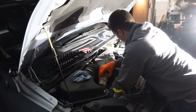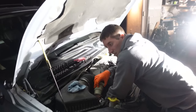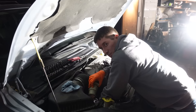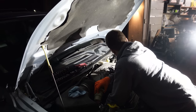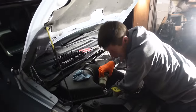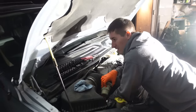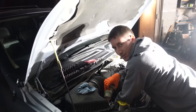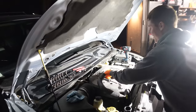Hopefully this fixes your whole problem. This thing still ticks, doesn't it? Yeah, we got the tick thing — it's been going on long enough so it might be more than just the rocker. We know it's a rocker on the left bank, don't know which one exactly, but it might've just ground that cam down a little bit. So it's just like a Hemi — eventually it killed its own cam towers. Dodge loves to build stuff that does that. It's already in there — that's how the marketing meeting went. A hundred thousand miles and it's coming back. New engine.